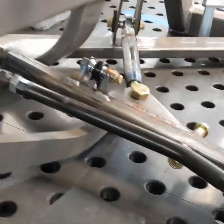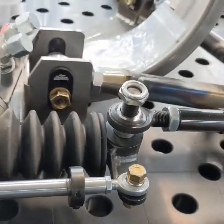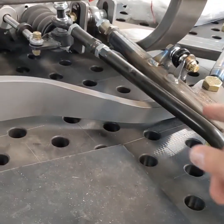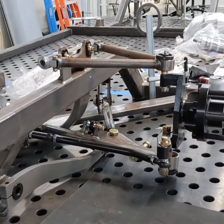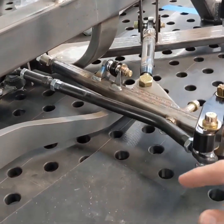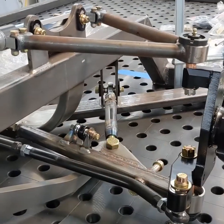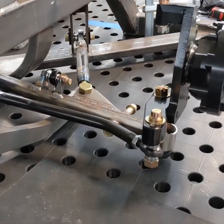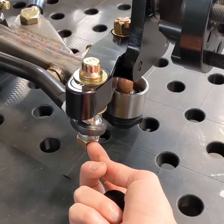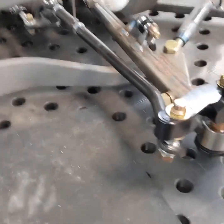This is a proper bolt, and you can see spacers under here — same with this straight bolt. Once the car is set up at ride height, I can adjust the height of this end link so it's fairly level at ride height. What that reduces is bump steer. If the end link is angled down or up at ride height, you'll get a lot more bump steer over bumps. Unlike a normal street car where tie rod ends are tapered, these use bolts with spacers, which is pretty slick.